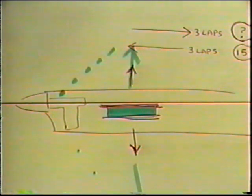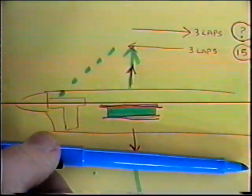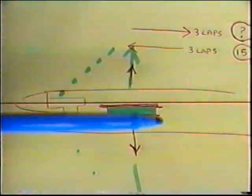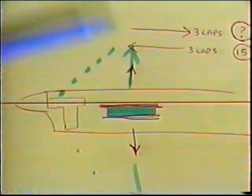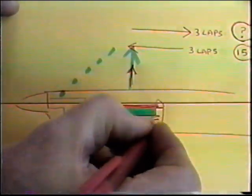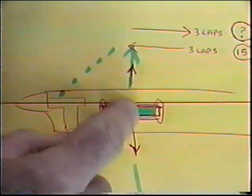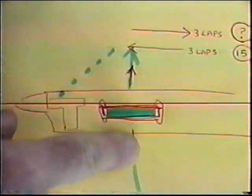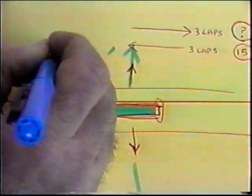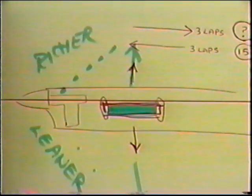So what I want to determine now is, what do I really want to do with this? The plane is flying. Do I want it to go faster in this mode or slower? Let's say I want the motor to slow down in level flight. Well, that means I want to raise this, in effect putting more fuel into the engine. If it's going too slow and I want to speed it up, I want to lower the tank. And in a full body plane, that would be putting shims in, or if you have those neat little Brodak ears that we soldered onto the tank, I can do that on a profile real easily. But know what the theory is. The theory is, when you raise this, the fuel is going to want to pour into the engine. As you move it away from the engine down, it's going to tend not to go into the engine as quickly and run leaner. You'd be amazed how many people don't really have a good concept of how that works.